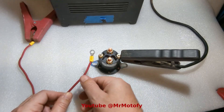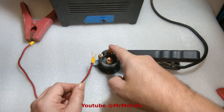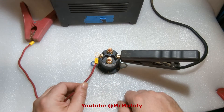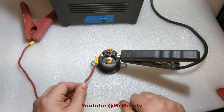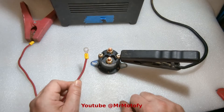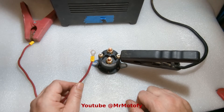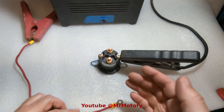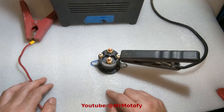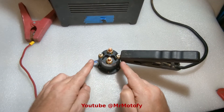Right now it would be off, so if your battery post was right here, you'd have nothing on the other side. But once energized, it bridges them — now you'd have power to whatever your load is. Very simple, very easy to do. They all kind of work the same way, so you want to check your wiring diagram and make sure you get your positive and negative correctly.